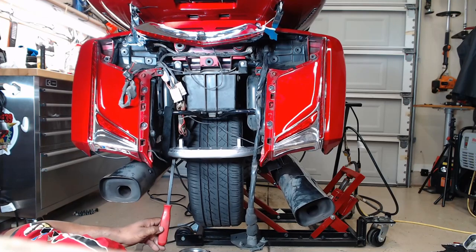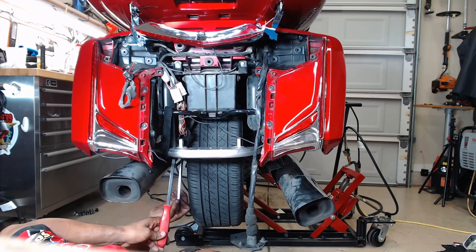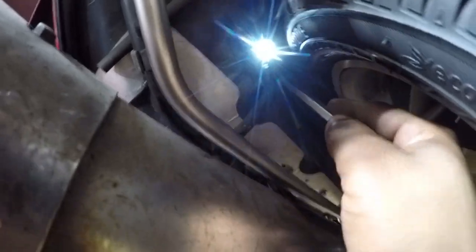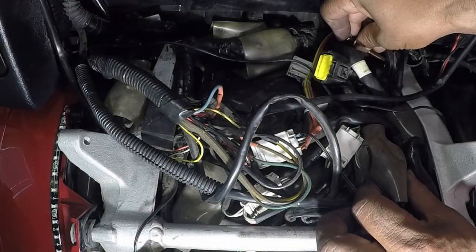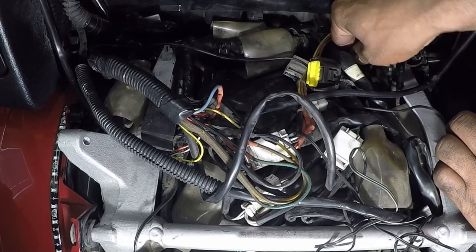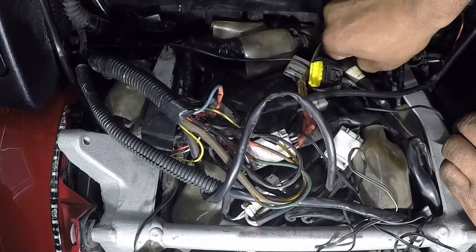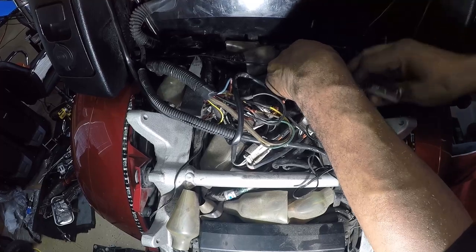In this portion of the video, I installed the left strut by placing it between the inner fender and the saddle bag. I used a long screwdriver to make an opening. Sometimes you may need to work the strut back and forth until you can get it to protrude through the top of the Goldwing. The strut is made in such a way that it locks into place when it sits on the frame. Once into place, install the 5/16ths by 2-1/4 inch long bolts, washers, and nuts from bag number 2 through the frame, subframe, and the struts. Snug them only — do not tighten.